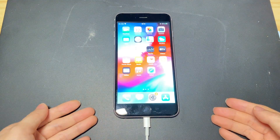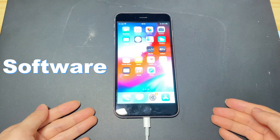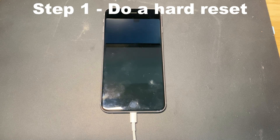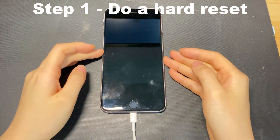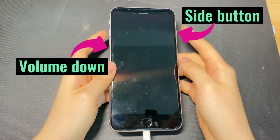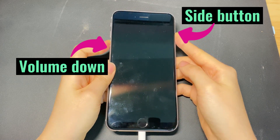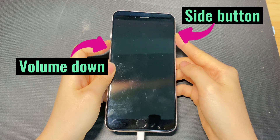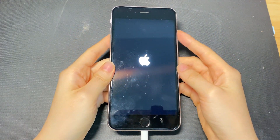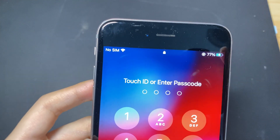Once you've done all the checking, use a USB cable to connect your iPhone 7 to the charger, plug it into a wall power outlet, and see if the charging problem is fixed. What's responsible for your iPhone 7 charging process involves both software and hardware. If your iPhone 7 is still not charging when plugged in or won't turn on at all, there could be a software problem. To fix it, you can do a forced restart first. It can clear out most software glitches causing the charging issue without affecting any data. Keep your iPhone 7 plugged into power and press the side button and the volume down button together. Don't release the buttons unless you see an Apple logo on the screen. Once the Apple logo appears, release the buttons, wait for the device to boot up, and then your iPhone 7 should start charging.